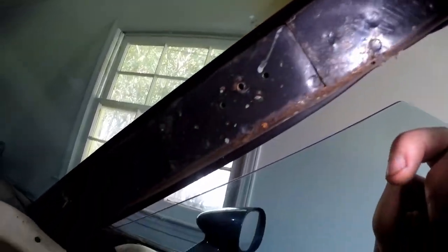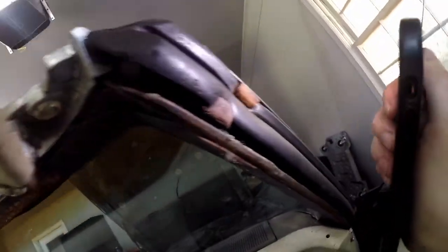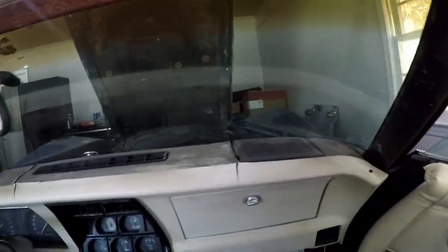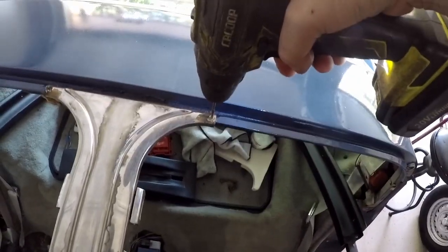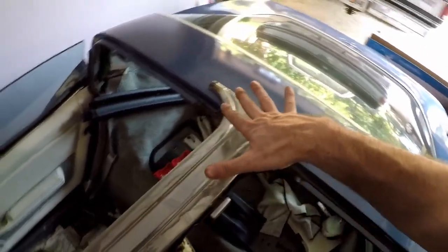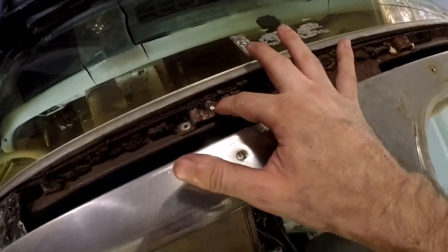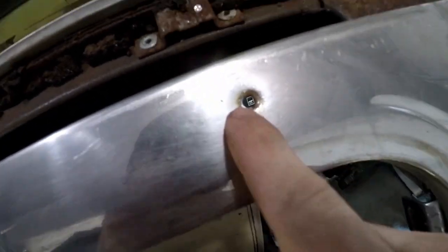Got the piece removed and once again it stopped right about here — this part is perfect, the A-pillar, so that's great news. We drilled out the rivet, went slow and stayed straight. The back rivet drilled out real nice. For the front, this screw we had to drill out — I just drilled the head off, got into the chrome finish a little bit, but it's okay.